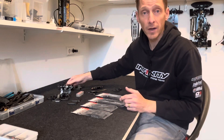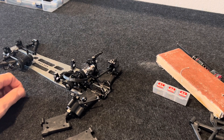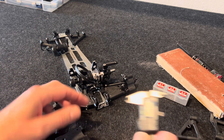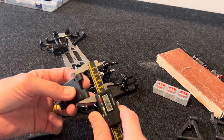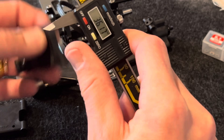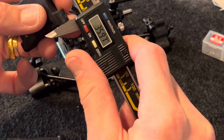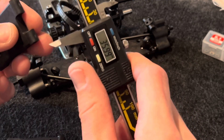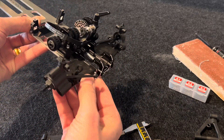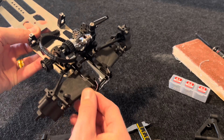Come and have a look at how I fix this problem. Starting with the rear — closer look at the car and the suspension. It's a minor difference but there is a difference: the hard suspension is 36.117 and the normal suspension is 35.97, so that's actually 0.2 of a millimeter. If you build it up with the one millimeter shim, the rear will simply bind.